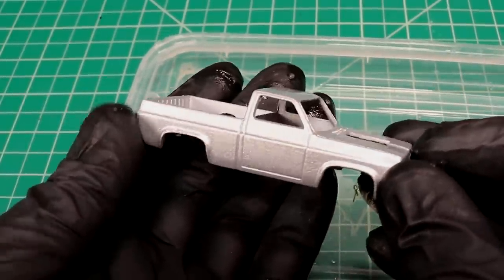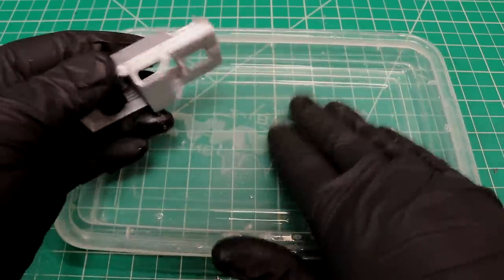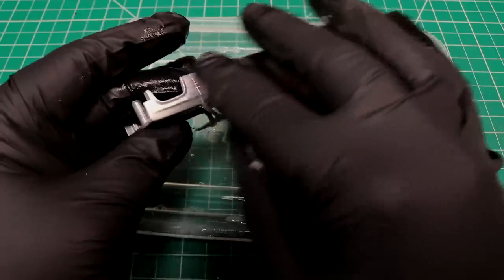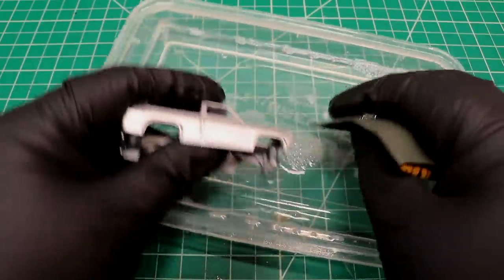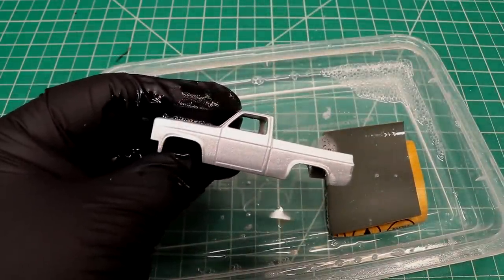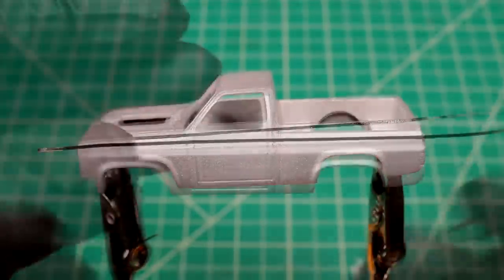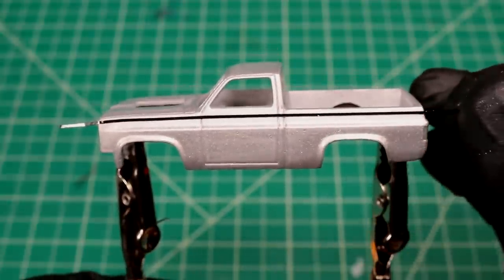I baked this in the old paint oven for about an hour - I had one thin coat of clear coat on there so she should be more than dry. Going to do a little bit of wet sanding. Usually if you're doing speed stripes and you want a real nice edge, it's best to just do the wet sanding and get it over with. I'm going to do our due diligence here - that should be good enough, it doesn't need much. Then I'll rinse off the soap and we can start doing some tape.